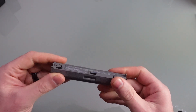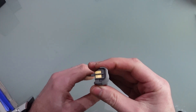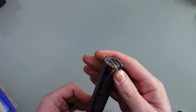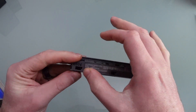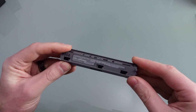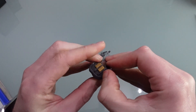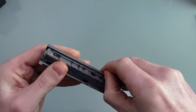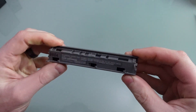Taking a look at the battery, it's got a couple of contacts on this side and a couple on this side, although I think these two might just be one contact fed underneath that plastic ridge — we'll soon find out once we open it up. We can see the batteries through these little gaps at the bottom and it does look like that's the positive end and that's the negative. Looking on the side there's a clear ridge running up past the contacts and then across through the back. It feels like it might be glued so I'm going to heat it up a little bit to soften the glue.